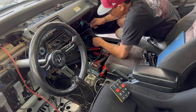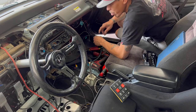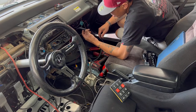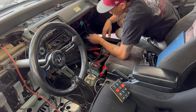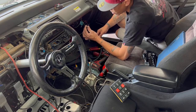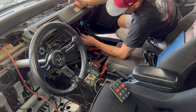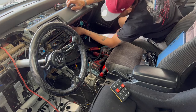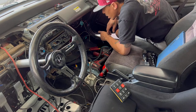I do have to wire in the fuel pumps and stuff, but I want to see if at least we get signal or power to the ECU. And then I'll go from there as far as continuing. So got this piece of 2-gauge. It's a multi-course stranded wire versus, you know, home wire that may have like 10 or 20 strands in it. This one has about 50 to 75. So the conductor is really nice. That's why welders use them, obviously. So just got a little elbow here mocked up. I'm going to crimp it up and then see about getting this on here and done.